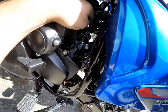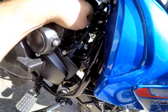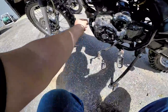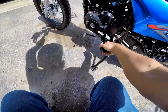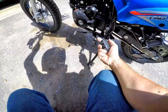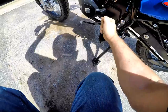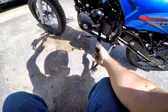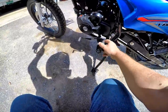The choke: that's choke off, that's half choke, and that's full choke. Don't ride around on full choke. You can use half choke while warming up, but make sure you turn the choke off. The newer Hawks use 8.8-grade harder bolts — the old Hawk did not have graded bolts. These foot pegs come out — you can use them either way. If you're riding more on the road, leave them on for comfort, but in the dirt and mud I'd say pull them out.